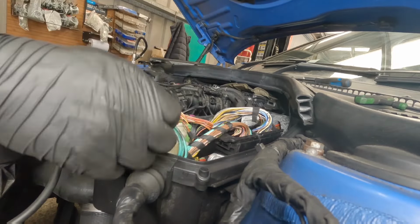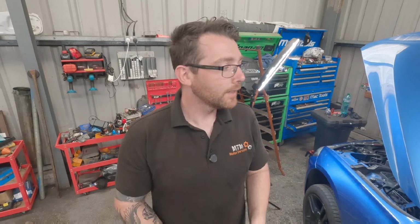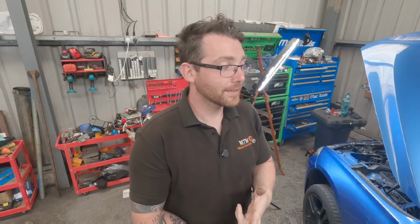I can't stress enough how important it is to double check your work after you've done anything. So especially with a coolant leak, we need to repressurize the system to make sure that it doesn't leak again, either from the pipe that we replaced or from anywhere else, causing a second leak that we have to sort out. Apart from making sure that it's got the correct amount of antifreeze in it and putting the under trays back on and some of the engine covers, all we need to do is make sure that the system is bled. I've done plenty of videos about how to bleed coolant systems, so I'll leave it for them. After all that, the car is more or less ready to go out on a road test, just to make sure that the fans kick in, fans are warm inside the cabin, just to make sure that everything is correct and right for the customer.